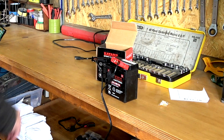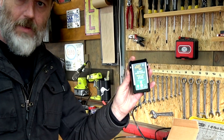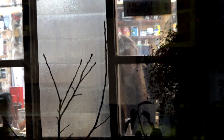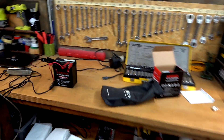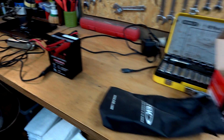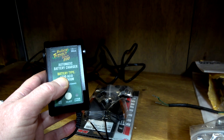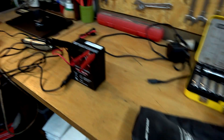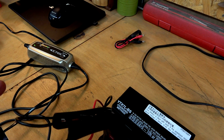Got the new battery - perfect bloody size. Brilliant. Now we're just charging it. Going to go have some lunch. It's now bloody night time - this day has not gone the way I thought. Nay's over in her shed building shelves. I started off charging with the Tender Junior because it had like 50% in it - it's primary use is to just trickle charge. I thought I'd use that on this new battery, but it went into float mode really quick and I thought that can't be right.